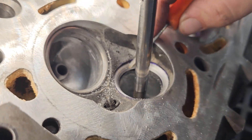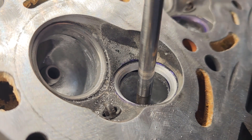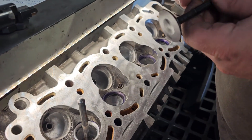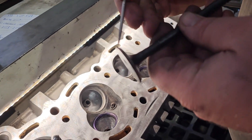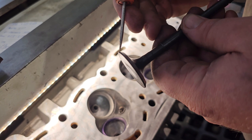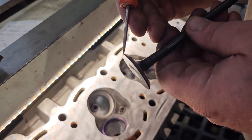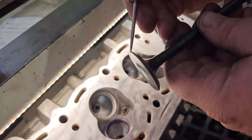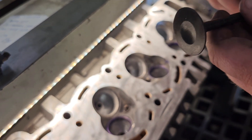With this part being a 45-degree angle, when I grind the valves I actually grind them at 44. So it's not a true 45-degree angle. Doing that puts that pressure on the seat right here, so that way it's at the edge.